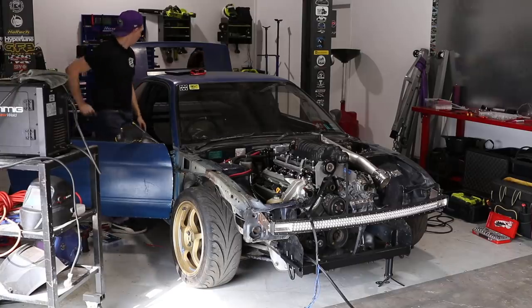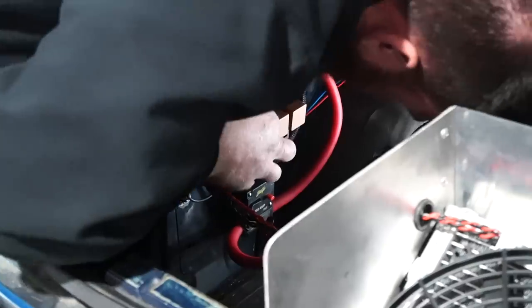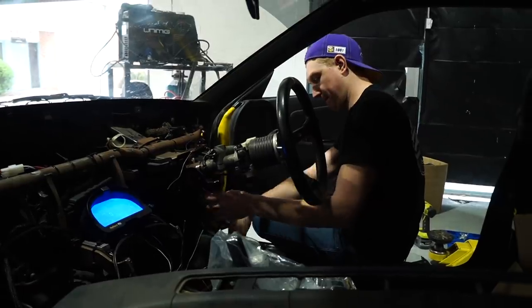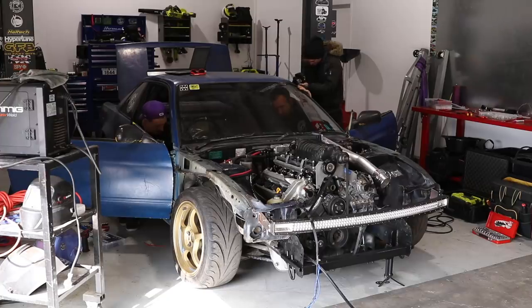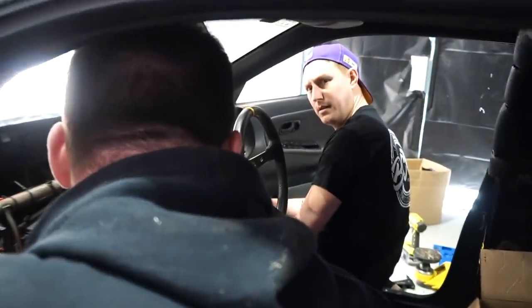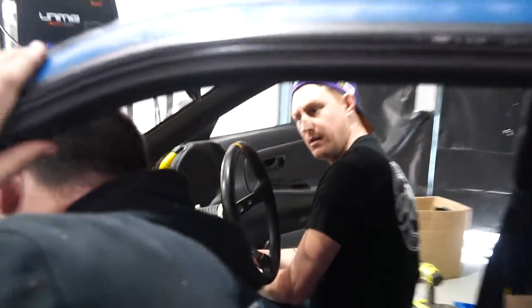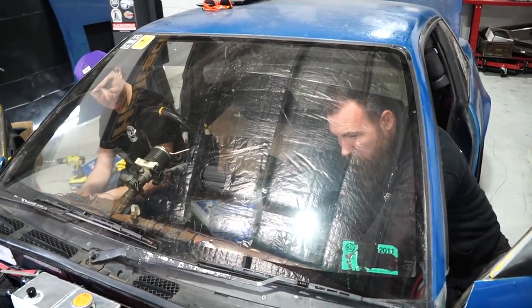Dumb question, all the fuses and relays are in this back box, yeah? Yep. Is the ECU actually on? Nah, ECU is powered. Oh! What? It's probably getting power from the starter post now. But we didn't tie it to the post. Yeah, there was a secondary one that says starter. I wonder if that's constant power, as well as whatever you've wired that up to. I wonder if there's some sneaky bridgey deal going on here.